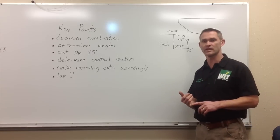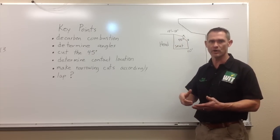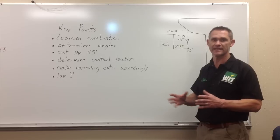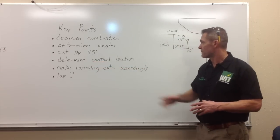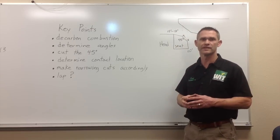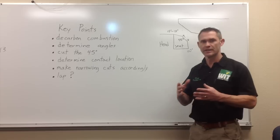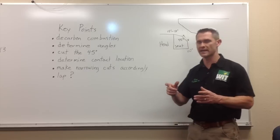If the seat would have been contacting too low on the surface area, cut with the 60 to bring that seat back up — which moves it up on the valve face. So just be conscious of where it's making contact. There's a product called Prussian Blue which a lot of engine builders use for the valve faces — great product. We used Magic Marker in the video, which is very accessible and still gives us the contact area, which is the main thing we were looking for. After making the narrowing cuts, ensure that it's in spec. Most of the heads we were doing had smaller valves — the spec was 0.9 to 1.1 millimeter. The seats will get wider as the motor wears, so you might want to go closer to that 0.9 area.